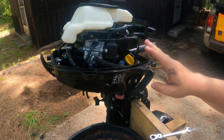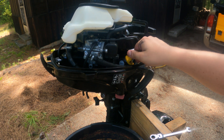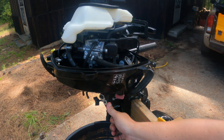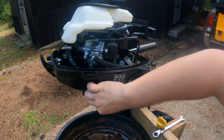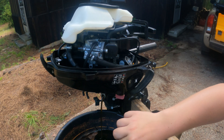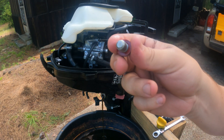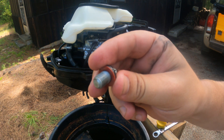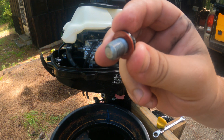To start the fluid changes, we're going to start with the engine oil. I'm going to remove this fill cap so I don't have a vacuum on the system, and then remove this plug on the bottom — that's the engine drain plug. I'll uncrack that and come to the end of the threads and let it go to the side. You can see there's a gasket on there. This gasket looks good so I'm not going to replace it this time. However, if it was pinched, I would strongly consider changing it — you can get a crush washer or one of these rubber ones.